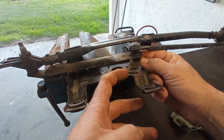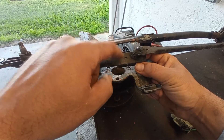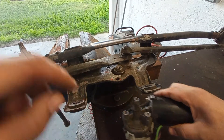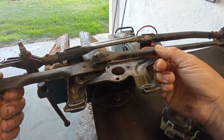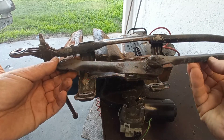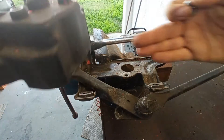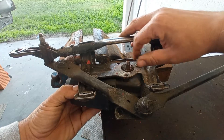To do that, you want to maintain this position of this part over here. The difficulty is really on this part because it has to be assembled underneath this plate, and that is where people do it wrong. People normally do it like this, and then to gain access to the nut that goes on top of the shaft they do it wrong - and that is the way that as soon as you turn on the wipers, they first go down and then up onto the windshield. You will want to have this in the most horizontal, straightest position possible. Don't forget the cover - very important for rain water. The motor must be in the correct position relative to the shaft and the assembly. If you have doubts, go to the car and try to fit it to check the space available.